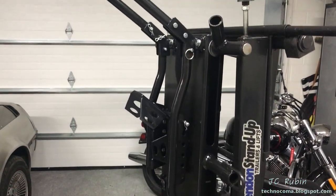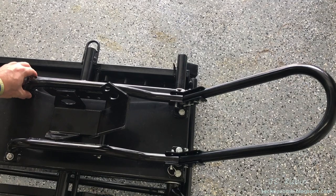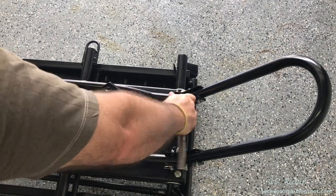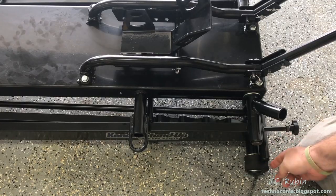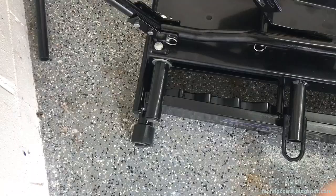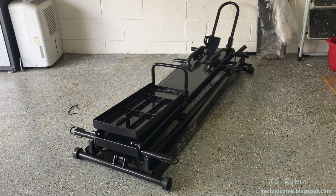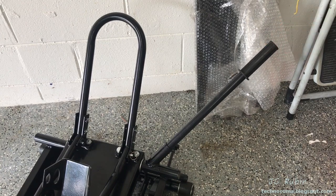All the parts are now assembled. I'm going to lay the unit down on the floor so we can tighten everything down. Now situated on the floor, I can dress the bottom rails, make sure everything is even, and tighten everything down. I'll also align the top brackets as I tighten them. There's a flat spot and a round spot at the front area — as I remove the cable ties, the flat spot is pointed down and everything's in position. I also want to make sure the handle for the manual pump has enough clearance, so I put that in and confirm there's enough room.